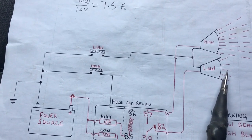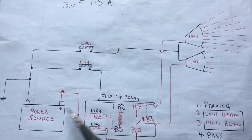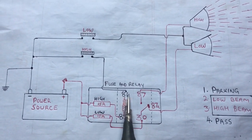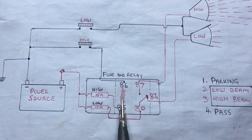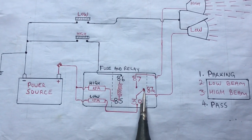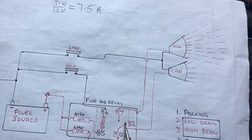When I switch the headlight on, I connect these two contacts and provide a path to ground — and the headlight beams on. Now when I switch the high beam on — this is the exciting part — I activate this relay. It has the supply on pin 85. I ground it, the relay gets activated, an electromagnetic current is activated on the coil, and that electromagnetic current pressure pushes the switch from the default pin 87A position to flip to the pin 87 active position. My high beam is activated and the low beam is switched off because we've broken the contact.